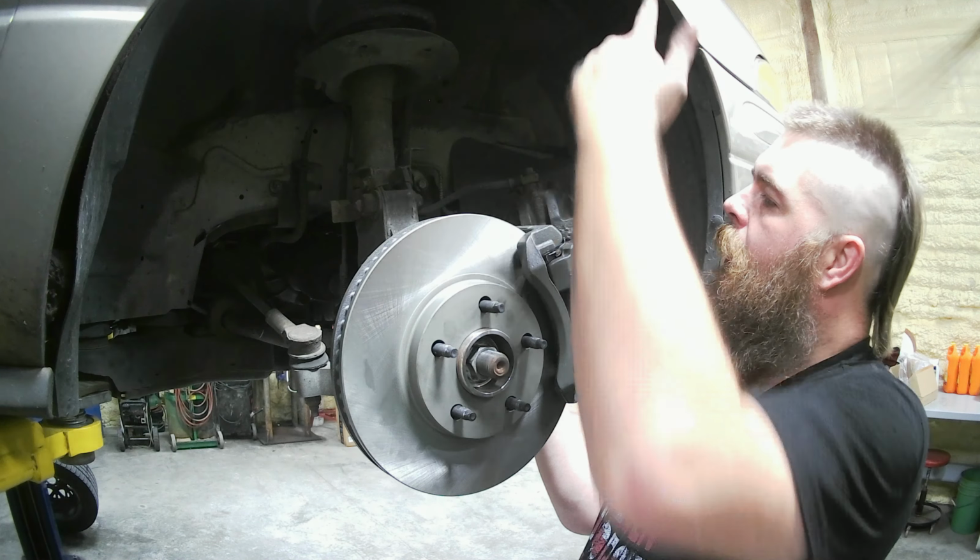We're going to go ahead and move the camera, set it up, and we're going to do all four corners of the brake system. Make sure we don't run out of fluid while we're up there. So every now and then we're going to have to go down, check the fluid level to make sure we don't suck too much out and put more air in it. We're going to go ahead and get all four of them bled, pump the pedal a little bit, check them out. They should be good to go, and then we'll take us a test drive.